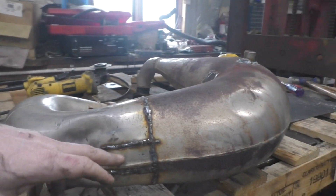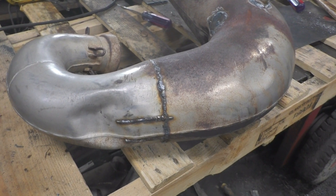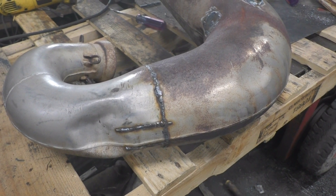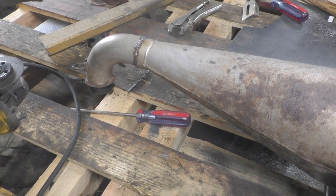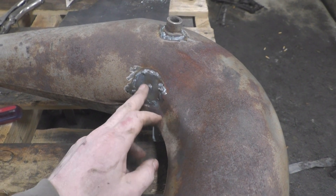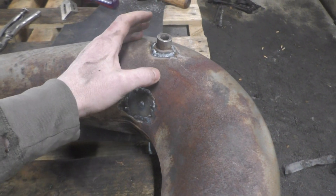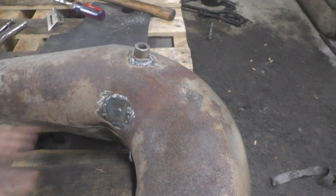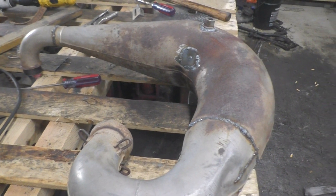The pipe's all welded up. I did some cuts so I could expand it out and bring it together — they're not the prettiest, but it's rusty, old, and thin. Maybe eventually I'll get a newer one, but this will be a good test. I spun it — it was pointing that way, now it's spun down. About an inch or so was taken out. For the exhaust temperature probe, it was right in the way of one of the uprights, so I cut that out, put a plug in, and moved it up here where it would be on a stock pipe for a Pro Climb. I'm going to clean it up, hit it with some header paint, and then wrap it in heat wrap.